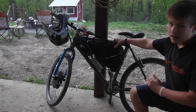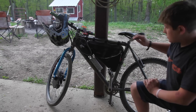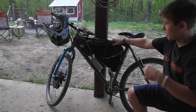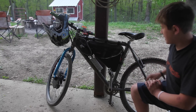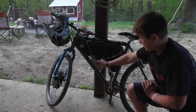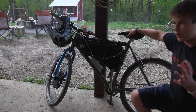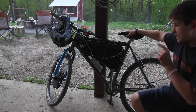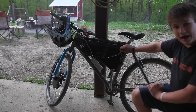Next I had to find a way to mount the batteries. I could have made a wooden case but people at home don't have a wood shop, so I bought a bag off Amazon for $12 — it fits all three batteries perfectly with room to spare, and it's padded. My wires are on the front bag which came with the kit, and my ESC is mounted to the bottle cage mount. For batteries, I'm using 6S batteries running in series — that's 75.6 volts going to the motor, which is rated for 48V, but it's been handling it fine and gives a lot more power and speed. Without further ado, let's test this thing out.